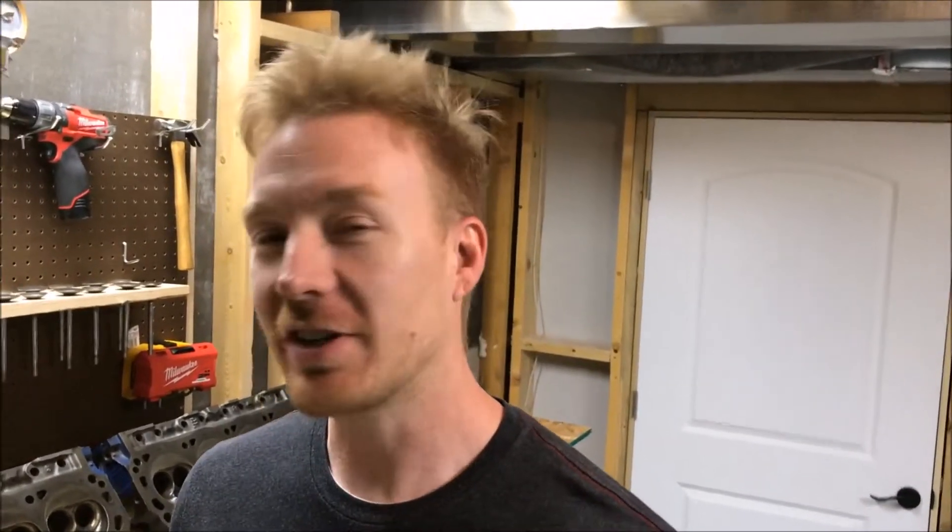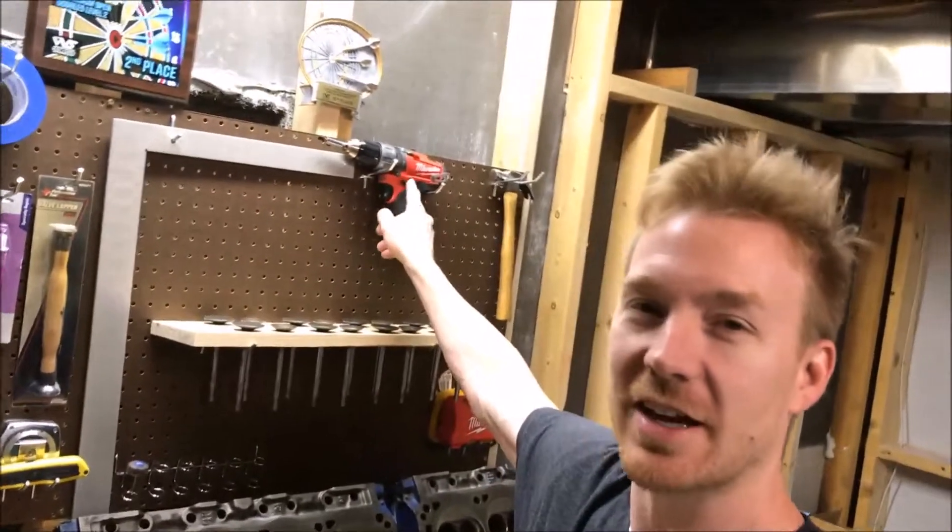And if you don't have a 17-inch drill press at home, I completely understand. You don't need one to do what I did. Really, all you need is a hand drill just like this and maybe a vice, or something that you can stabilize the hand drill with. You just don't want the drill moving at all when you're conducting this test, because really you're just looking for wobble. Any inputs not strictly limited to the drill spinning are going to throw off your observations. So just make sure you have a nice stable platform if you're going to try it like this. The heads were off the car, so there are a few other ways I could have gone about verifying if the valves are bent — obviously measuring and stuff like that. But I thought this was a cooler, more visual way to check. Obviously, they're bent. So we're a little screwed there.